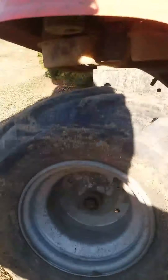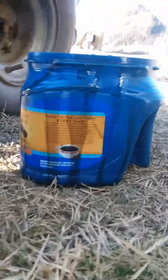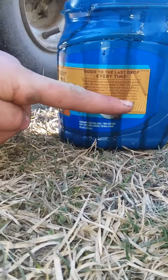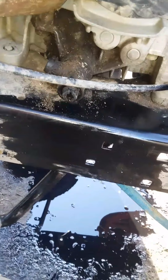About that much of the tire was sticking up, so this was completely underwater. I pulled the spark plugs right after we got it back up here, then I drained the oil. Here's what was in it — about that much of it was water. So it definitely got some water in it. Half the oil I drained went out on the ground because it was flowing everywhere.